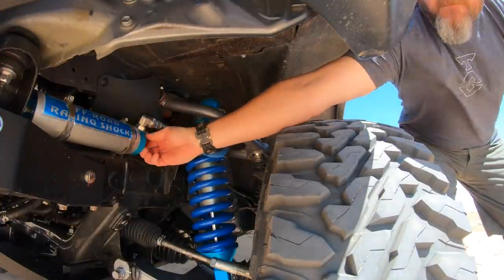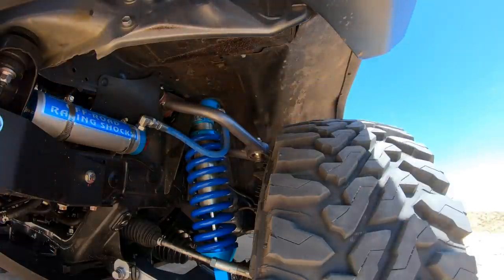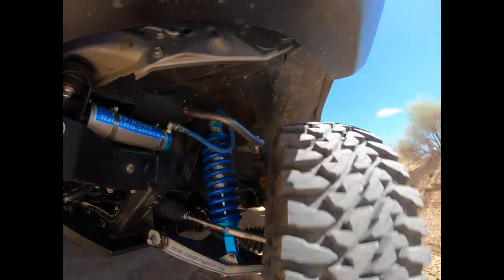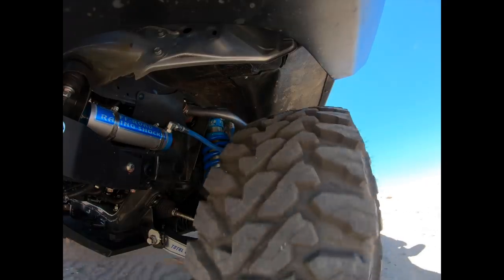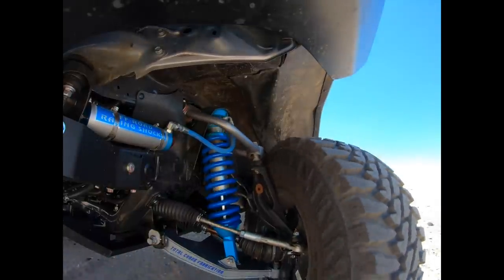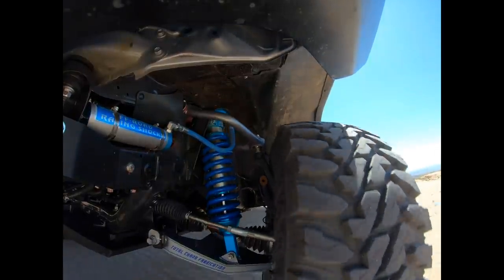For the front suspension on this truck, we're running the Total Chaos long travel plus 2.5 long travel. So that's 2.5 inches wider per side. That is what we consider our stage two. And the stage two consists of basically the long travel King coilover, upper and lower control arms from Total Chaos, spindle gusset, cam tab gussets. We're running RCV axle shafts up front, CVs. That's basically a stage two plus. That's included in our stage three. It's an option for the stage two. This one here, when he went ahead and opted for the stronger axle shaft up front.